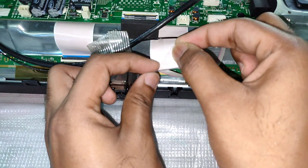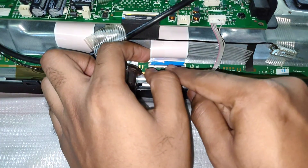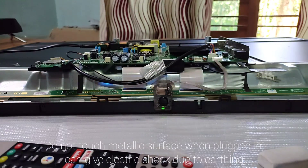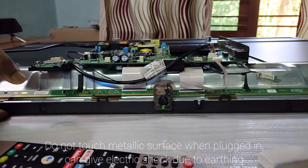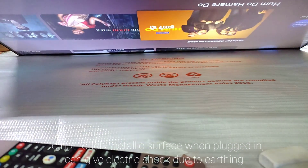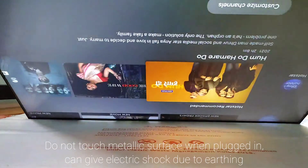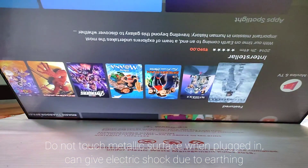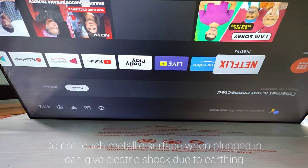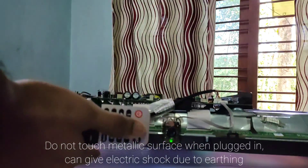I exposed some more lines, so this time it should work. I locked it back and powered it again — that was the moment of truth. And yes, we got the image! It's working. The region may vary — it may be on the left side or the right side, so you have to check by slightly masking and removing the tape. If the damage isn't beyond a certain level, it should work. But if you keep watching with the short circuit still there, the damage will further expand and it will become less repairable.